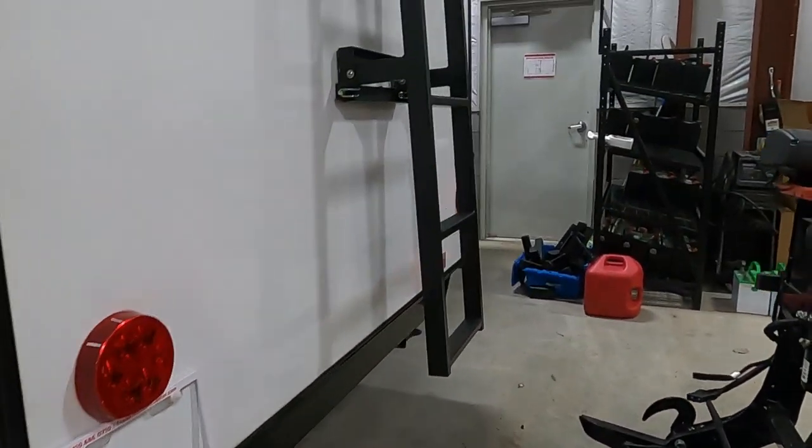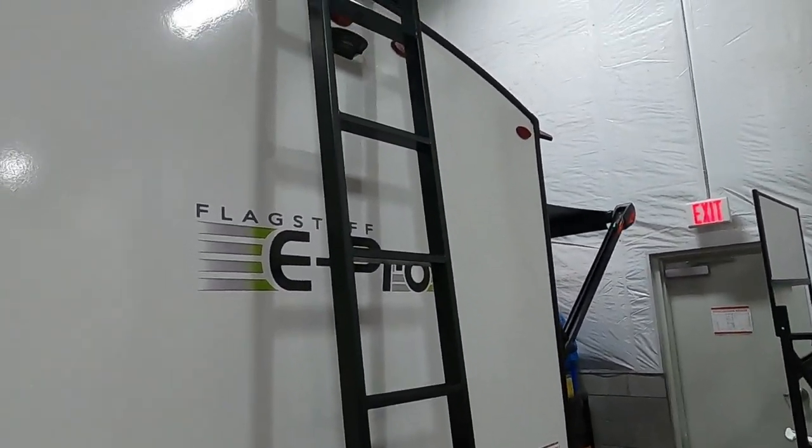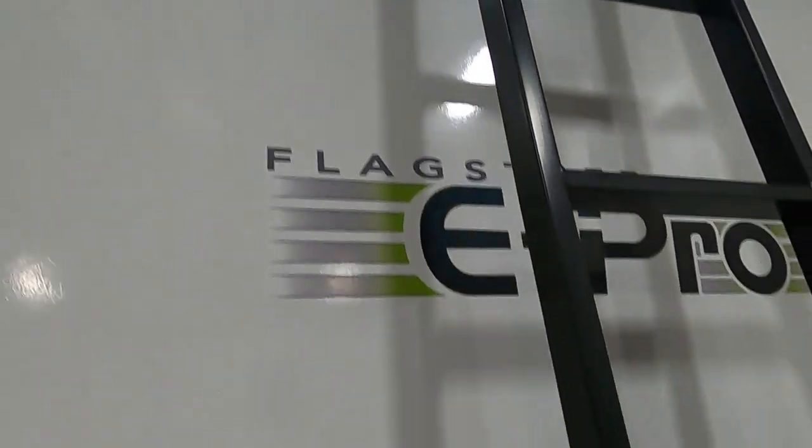In the back, you got a ladder, utilize it. Go up there a couple times a year, check the seams of your roof and caulk as needed with recommended RV roofing caulk. You also prep for a backup camera here. Furion sells one. Device sits on the dash of your tow vehicle. Another device attaches to this, giving you a backup camera for the unit.